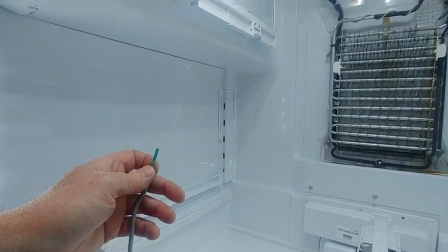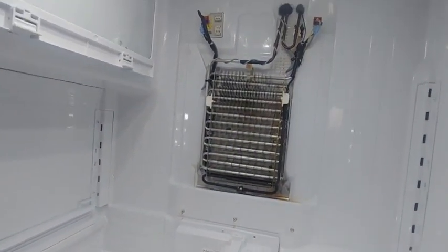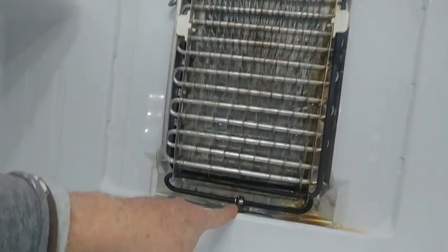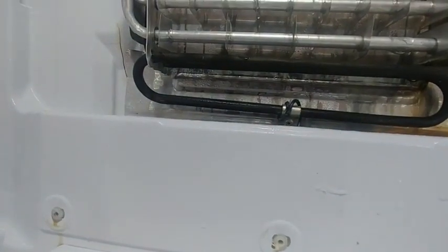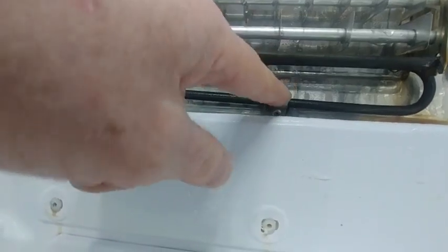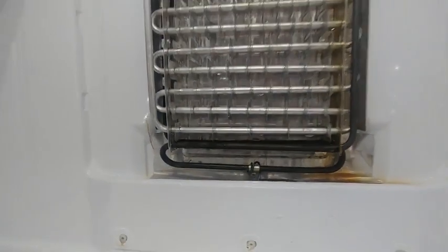Don't forget to put the fridge back on again. Also — this is kind of an update video, but just in case anybody finds this first time — it's a good idea to exchange the drain hole for this, because it ices up. You get a longer-tooth version. I just wrapped a hunk of copper wire around it and it seems to do the trick. You can buy the other ones — my other video has the part number for that.